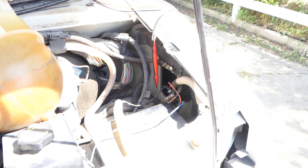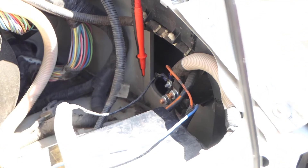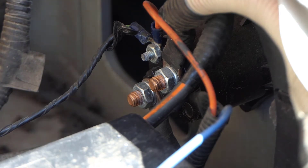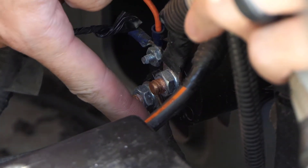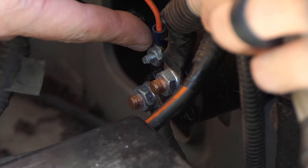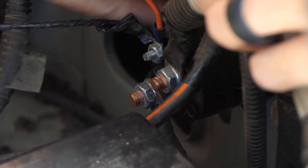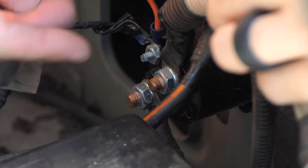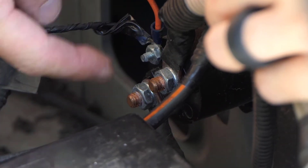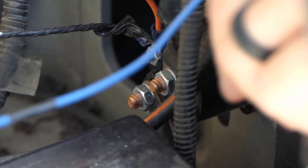Back underneath the engine on the driver's side, there is this solenoid right here. This is the solenoid that connects the starting battery to the house battery. We can see it looks like we've got two trigger wires that go to this terminal, and then we've got one battery cable that comes in on this side and the other battery cable comes down here. There's not a fourth terminal, so that means this solenoid uses its ground through the bolts into the frame. So it's always grounded — it gets the trigger wire from the ignition switch, and then that closes these two terminals.